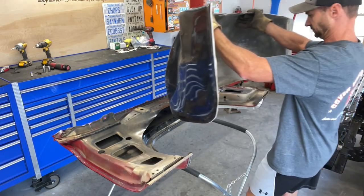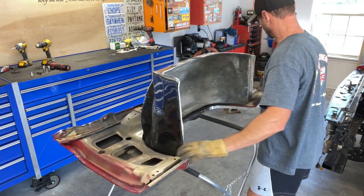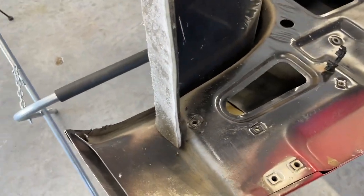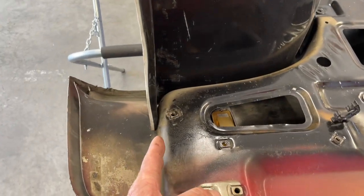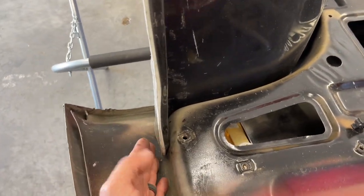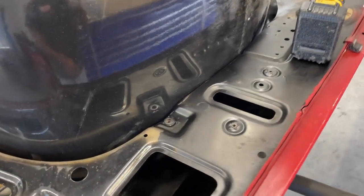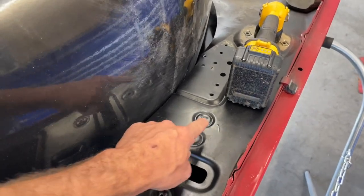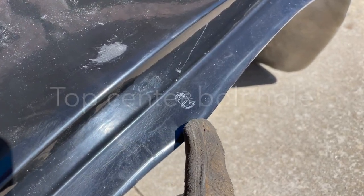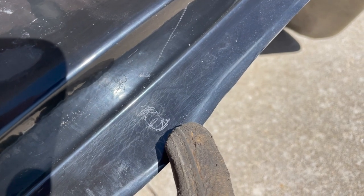Make sure you have a good pair of gloves when handling this fiberglass, and set it up on the fender. For those of you with your fender still on the truck, you may have to implement the buddy system for these next steps. If you did take your fender off, keep in mind your radiator support is going to have its base kind of flush with the bottom of the fender. When you do this test fit, rotate the inner fender so it makes full contact against this body line. The first hole you drill — scribe the center hole out if you can reach in there. Passenger side is much easier because it has more reliefs in the inner structure. This one is absolutely the hardest to get to in the whole project, and you can see how it compares to the marks that were made when these were shipped to you.